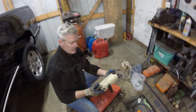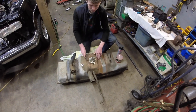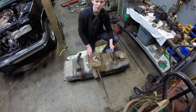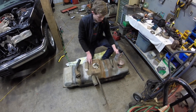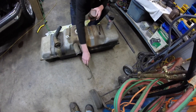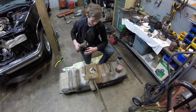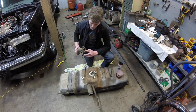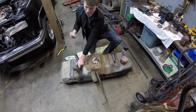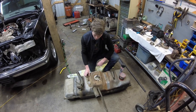When we go to put this back in, we're going to put a little grease on the O-ring right here, clean it up a bit, put it back in place with the metal snap ring, and we'll be ready to stick the fuel tank back up in there. We took this gas tank out a few days ago and noticed a lot of rust. We're going to keep scraping off all the big rust spots and then put some cover paint on there so we won't have to worry about rust forming and causing leaks. We're also going to lube up these rims with grease so it fits nice and tight. And since we're putting a diesel in here, we're going to drill out the filler neck inlet to accommodate the larger diesel nozzle.